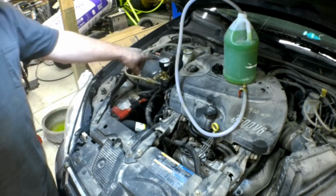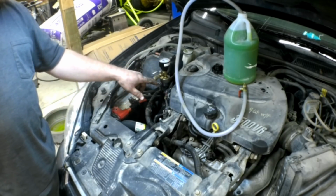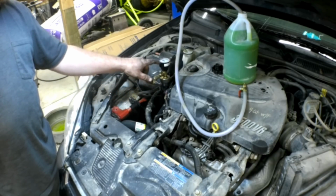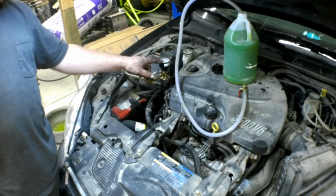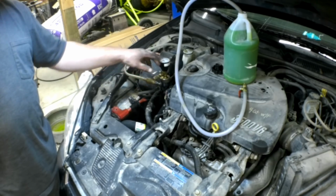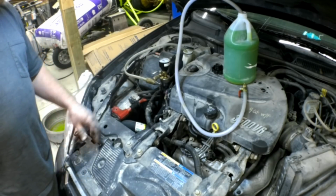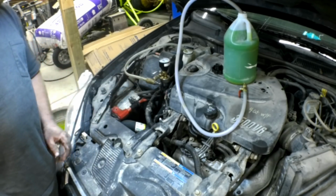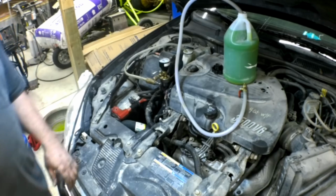So I'm going to move you so that you can see this gauge here, and I'm going to hook my airline up to it. And if I did everything right, we should be able to get to about 25, 26 on the needle here. When we remove the vacuum source, it should stay there for maybe 5 or 10 minutes, and we know we're good.